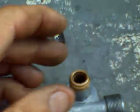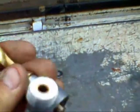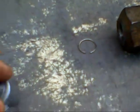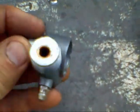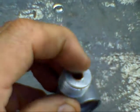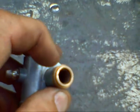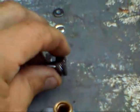By the way, to check that bushing, get a 21/64th drill bit. Just drop it in there — you can hold it up, look for light to shine around it, look for it to be wobbly. Ferrer's is fine, mine was fine. Houston may have actually done a better job on this bushing than Smiths Industries did. This bushing here is dealing with all the stress of being inside the wheel, so it does wear oblong. And when it wears oblong, it will allow the spur gear to drop away.